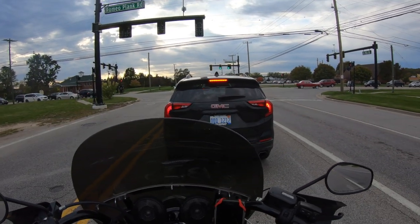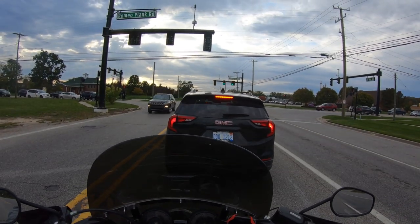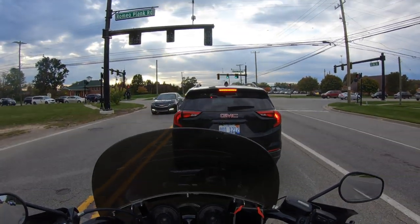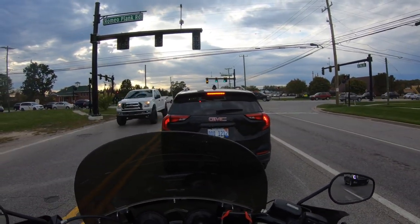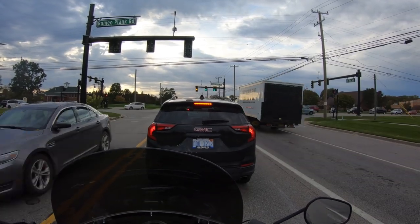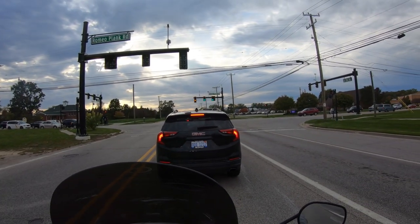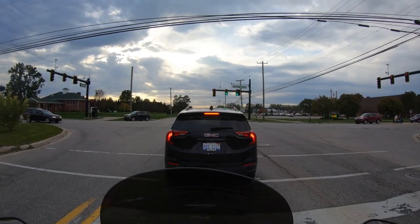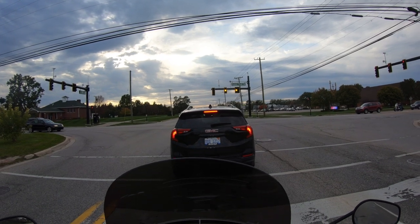Like I said, this is all based on factual information along with a little bit of assumption, because until you tear a touring model motor apart, which T-Man has done, so I've seen video of it, you can't really know exactly what is causing the issue. But the whole reason T-Man designed that is because the crank is throwing a lot of oil and it's not getting to the return where it needs to go.